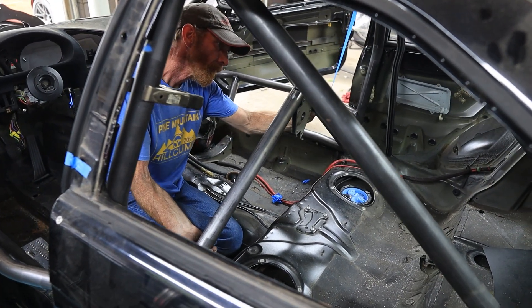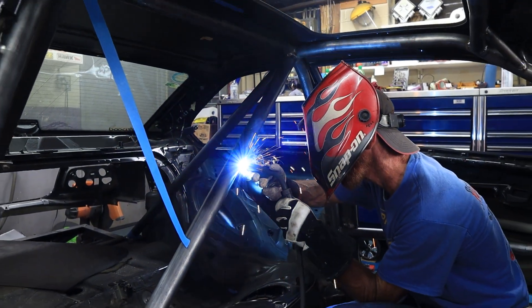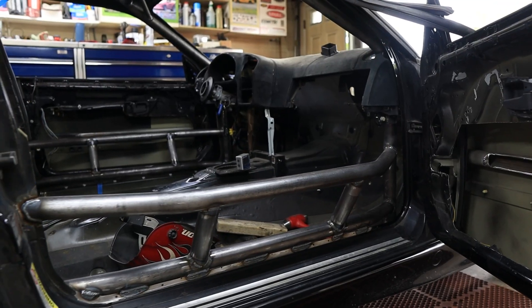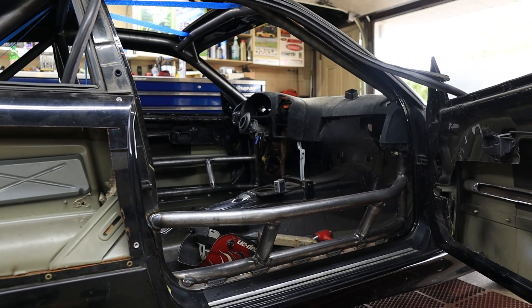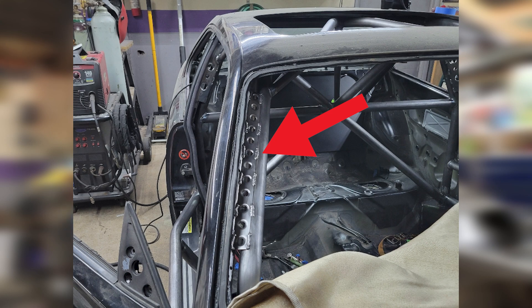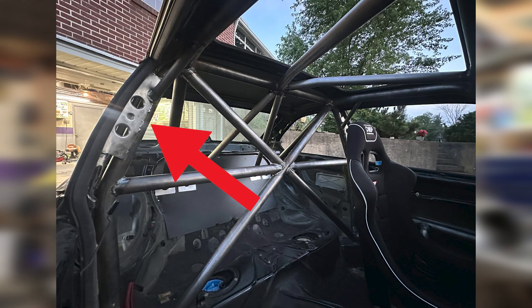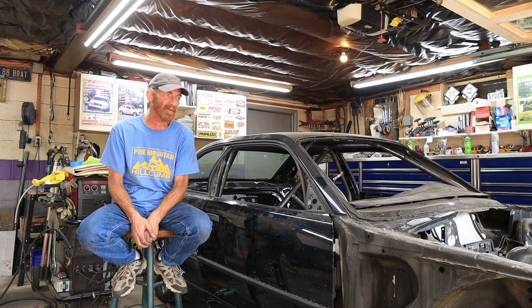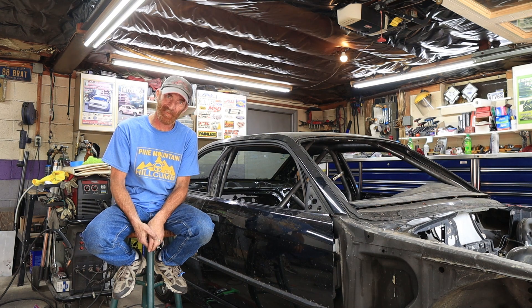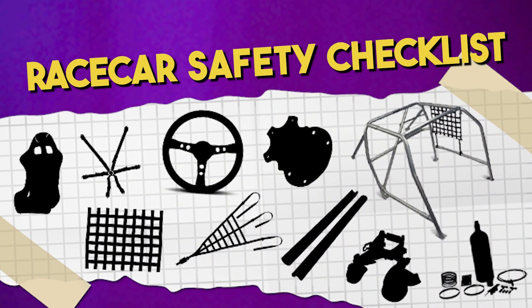This particular one was actually a lot of fun though. Ethan gave me basically carte blanche to do whatever I wanted with it as long as it passed tech. So we did NASCAR style door bars on it. Lower rocker bars are welded to the rocker plus the cage itself. It's going to get gusset plates right up along the A pillar and some gusset plates along the B pillar. It's really going to help tighten up the chassis quite a bit - no more flex in this thing. So with a big thank you to Mike Robinson from MSR Performance, we can successfully check off the cage on the safety equipment checklist.